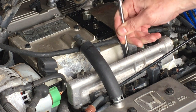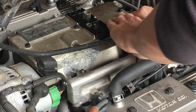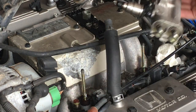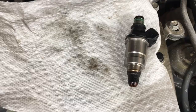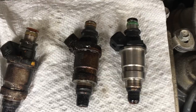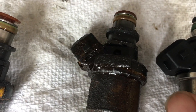Not a bad idea to have a magnet tool around in case you drop one of these fuel rail nuts. With everything out of the way, now it's time to remove the fuel rail. The injectors are all that's holding the rail in place right now — it might take a little pull and wiggle to get it loose. One injector came out with it, just pull that guy out. Make sure those crush washers don't fall off. Wiggle the next one out — that one looks gross. And the last one up front, also gross. You can tell the one on the right was replaced at some point — it's an aftermarket injector with no writing below the tab.